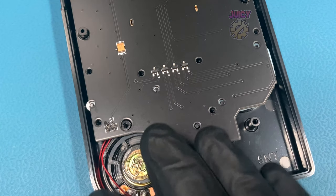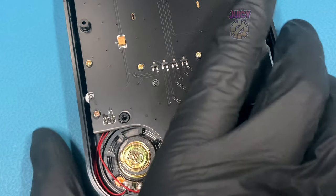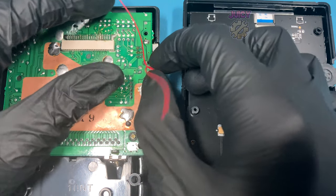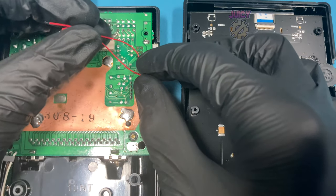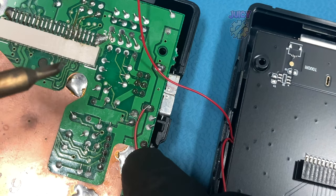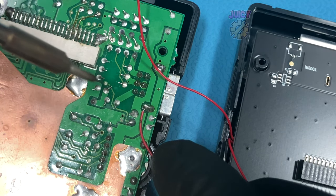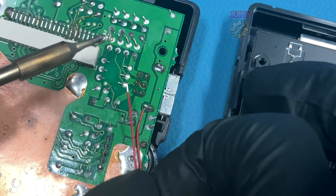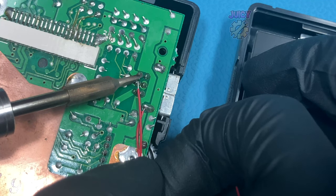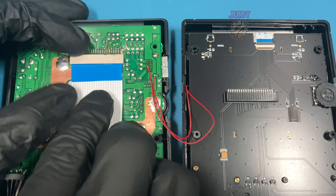Something I may have forgot is to put the screws into the front half — there are quite a few so let me do this now. With those screwed in, we can get both halves of the shell together — this is where we connect up the TV out portion of this IPS kit. I'm going to cut the wires slightly shorter and attach them to the external connector. The ground wire marked with black goes to any ground point on the board — I'll use the external connector's ground pin. The AV out wire needs to go to the middle pin on the furthest left row, making sure not to short any other pins. I left a little leeway so I can play around with the two halves of the shell.